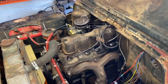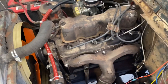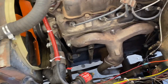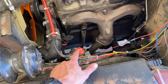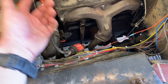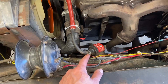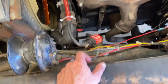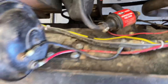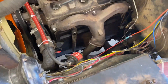We were putting it in the other weekend and were getting a bit of a time crunch to get it running so we could go four-wheeling on Sunday. One of the problems we ran into was the fuel pump. I did plan on running a stock mechanical pump, but the pump I had crapped out — it wasn't good from new; I think it was an issue with one of the check valves. So we're just running a Mr. Gasket 42S electric pump, wired to the key switch. Seems to be running fine.